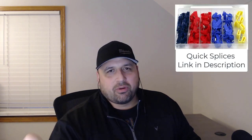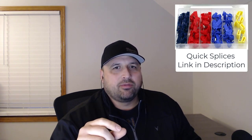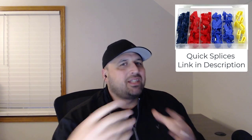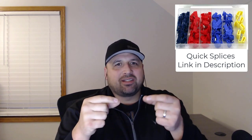So the way that I do prefer, which I'm going to show you in a second here, is to take what they call wire splicing kits and be able to splice the wire in. So I'll get to that right now to show the way that I like doing it. The only downside of these is that you sometimes have to stagger them down the line. You can't do them all side by side because it just creates this big bulky bundle. So usually I do it a little bit further back for one and then keep moving it forward, so eventually the overall thickness of the line is only going to be one of the splices thick. So here we go. Here's how you do it.